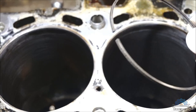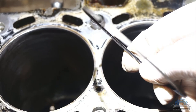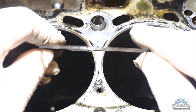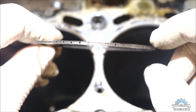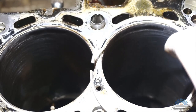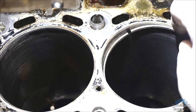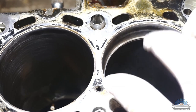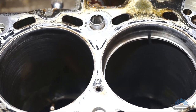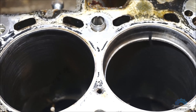Many people on YouTube are dismantling engines showing the problem — that's fine, please spread the info. Just remember where you saw it first: Elbow Grease. Many people say the rings are filled with oil, so they're not draining the oil down — that they're just clogged with carbon deposits. That's not true. Please visit my website, Elbow Grease DIY, and you'll see my own M54 ring. Can you see the gap? With six pistons and six cylinders, each with a gap like that, loads of oil is lost.